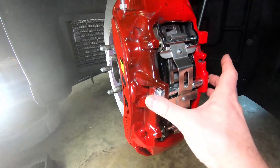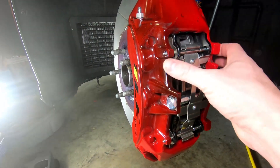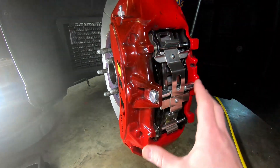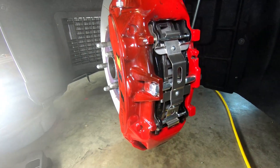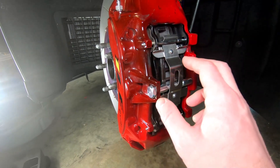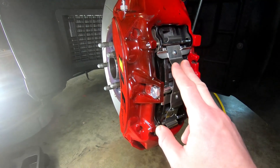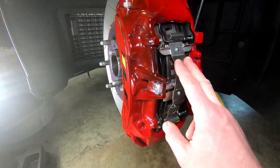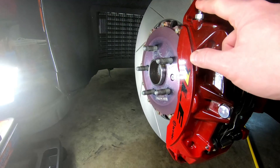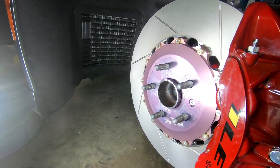Here's all the new hardware — both the pin, the spring, and the pad pins are all brand new. I'll put the part numbers in the description. You should change this — not every pad change, but it's not good forever. These have failed on people's cars, especially with track use. Speed bleeders, and then these nice, beautiful zero-hour rotor discs.